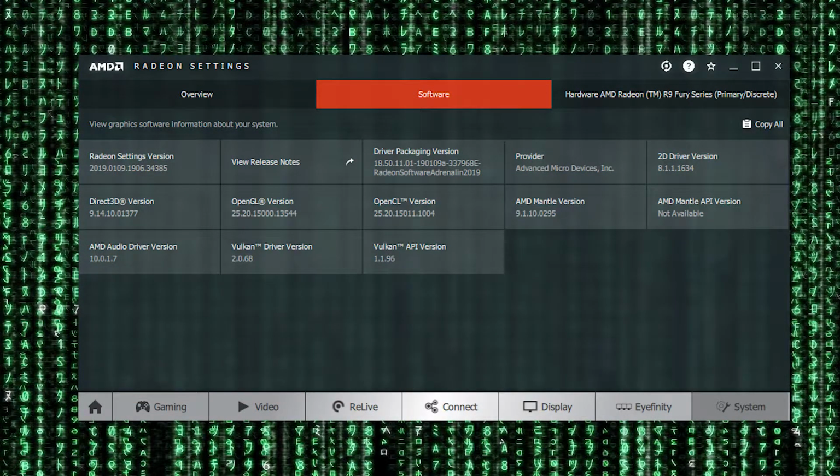All of these benchmarks were done using the most current 2019 Radeon driver. I believe it's the 1850 revision. So we can rule out any optimization as a source of performance increase or decrease. So I guess the real takeaway at this point is there's no one-size-fits-all solution for overclocking your GPU. There's a lot of factors to keep in mind, such as API, software optimization, and the speed of the memory on your card. So to get the most performance out of a particular piece of software, you should probably benchmark it at a few different speeds and see what gets you the best results.